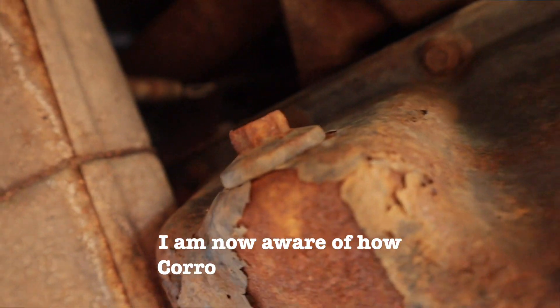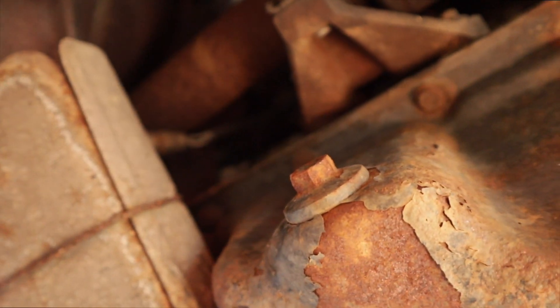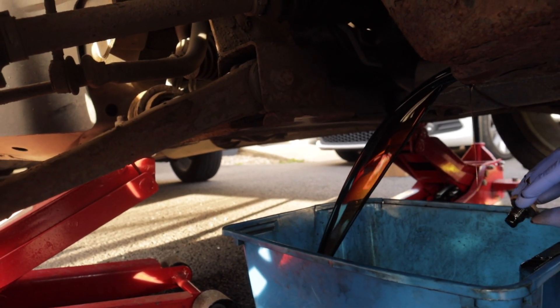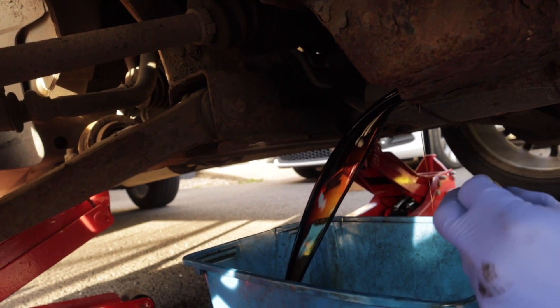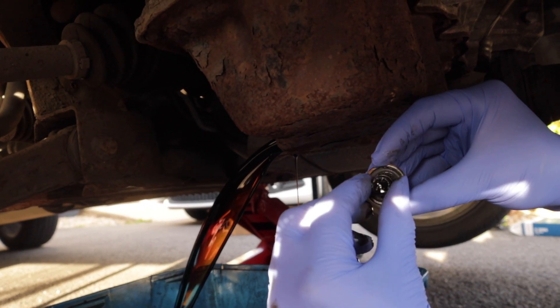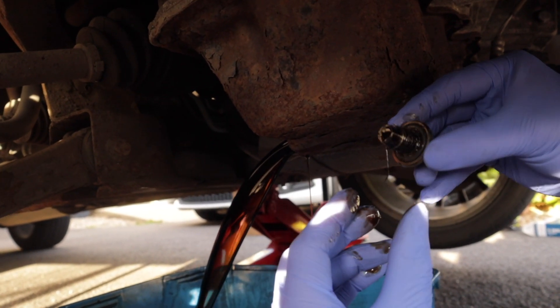Next thing we want to do is take off the sump plug, which is a 13mm spanner. We're just going to take that off and drain all the oil. There we go — it's quite a lovely colour, not as black as you'd think but it's pretty black. And it did basically boil the other day. Also, there is a magnet on there, so any swarf catches any of the crud — look, little bits of rubbish.